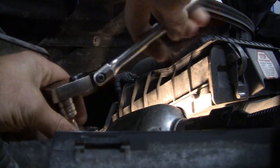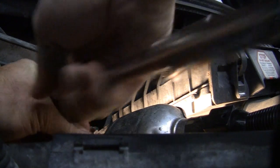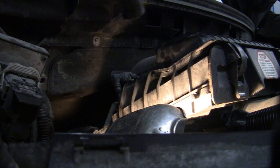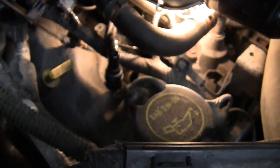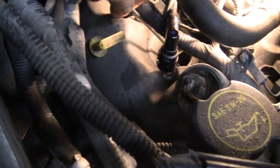Now, if you don't have combustion chamber cleaner, any kind of WD-40 spray should work. Ford recommends their Ford carbon cleaner, or whatever that's called. Now, we'll get a magnet stick down there and get that spark plug out for you. Okay, get yourself a magnetic stick or something like that, piece of vacuum hose, and get that plug out. Hopefully. It seems to be stuck in there.